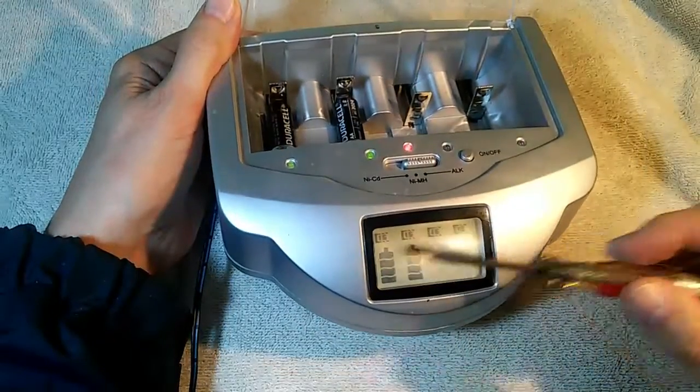These batteries have been on this dumb charger for a couple of hours. Let's check the voltage after their third recharge: 1.55 and 1.55. We're going to put these batteries back into the smoke alarm — one more go. The smoke alarm is chirping again after the third recharging of the batteries. This time the charge lasted only 20 days — that is only 3% of the original time of 713 days.